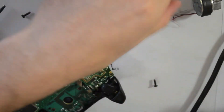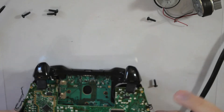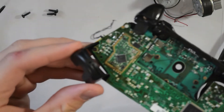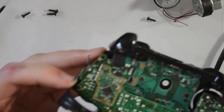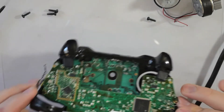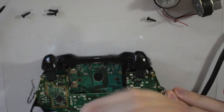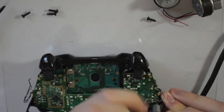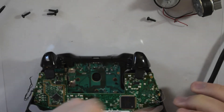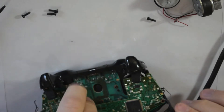Drop those — this one comes out the bottom. Then you have this PCB board. There are some screws here on the bottom; these are slightly smaller Torx and they're not security Torx. So get your driver and take all the screws out. The big ones hold the shell together, the small ones hold the boards in, so you can't really mix them up.